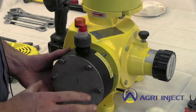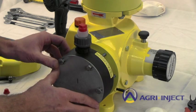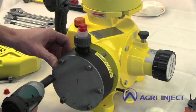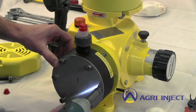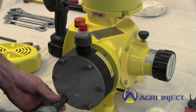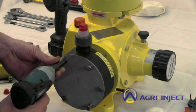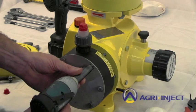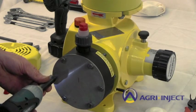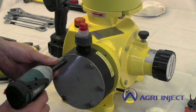As we tighten the head bolts, we don't want to take one of them all the way in and then start on another — that will tilt the head. We want to bring in all six of them until they're all snug and touching. Once they're all touching, then we can tighten down.